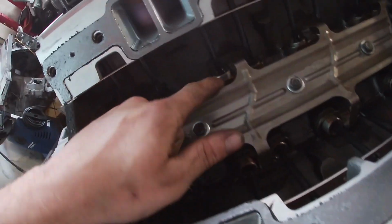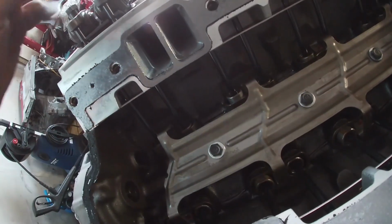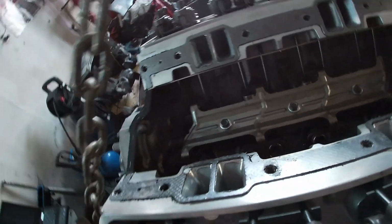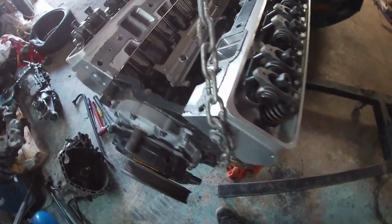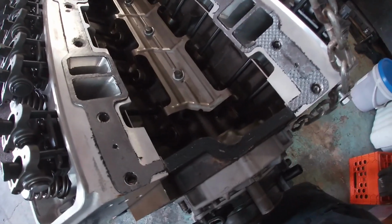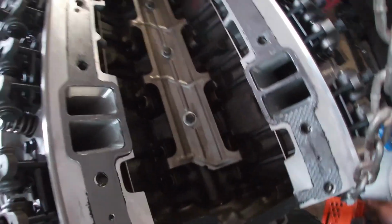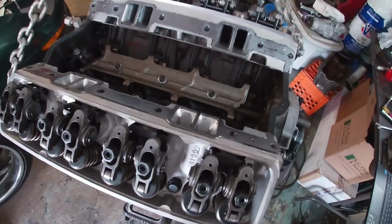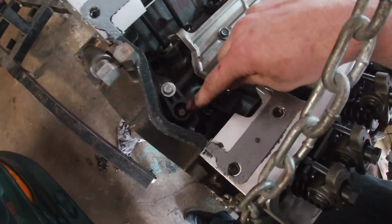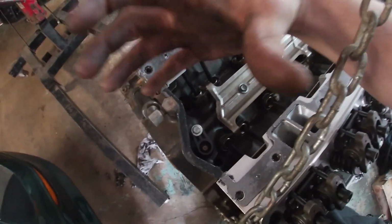These ones here that are hard right now, that is the intake opening. So down inside. Okay, so looking at this, the lash is close. Somebody eyeballed it, but our lifters have no oil in them whatsoever. So to prime this system, best thing to do is outside the vehicle. It still has the hole like the old distributor from the 350s, you know what I mean? If you guys ever worked on an old school 350 or whatever, the distributor's right here.